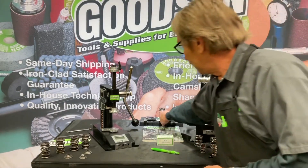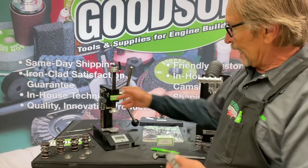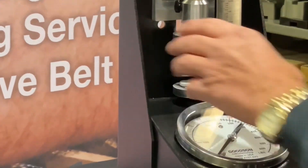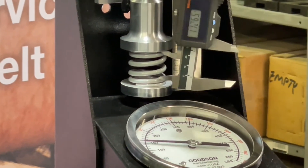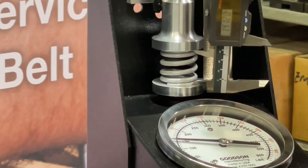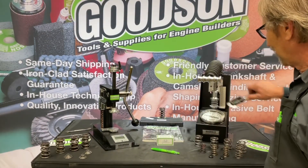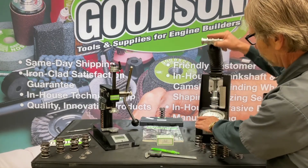I'm going to put the calibration spring on the analog machine first. I've preset this with my dial caliper to confirm I'm at 1.400 here, and I've preset the digital unit at 1.400 open spring height as well. So I place it inside, bring it up — 1.400 confirmed on my gauge — I'm getting the recommended poundage, right at 138 pounds. I'm a little bit over on my adjustment — could be the nervousness of doing this video — but right at 1.400 I've got my 138 pounds.